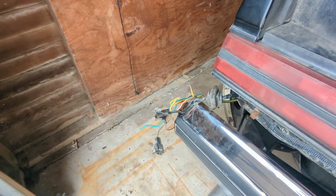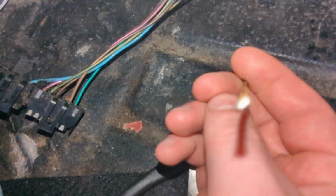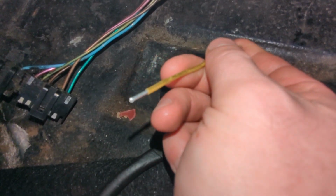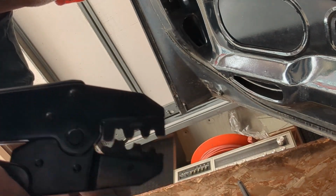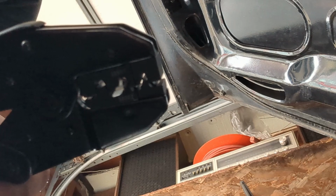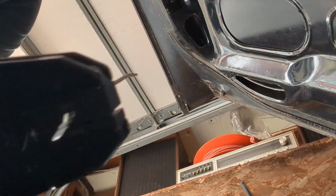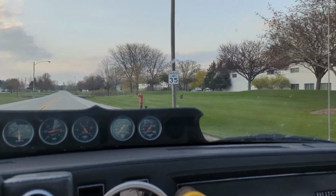Wiring a 4-pin into the car was a real treat. I ended up breaking one of the wires off in the vehicle connector. In the trunk there's a connector that goes from solid core wire to multi-strand. And of course I broke the side off that was solid core right in the connector. I ordered the correct pins for the repair job and will finish the job by tapping into the multi-strand side.